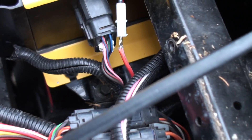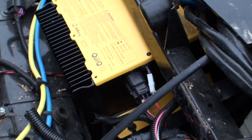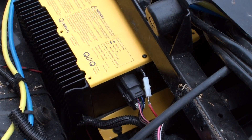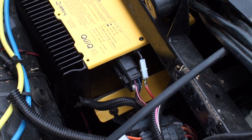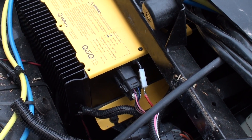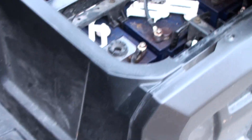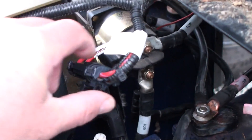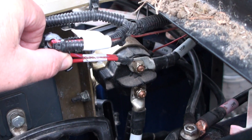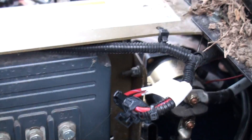Once I got this terminal — that one red wire connected back to the inside — basically my plug just runs through the side and bypasses the big plug. So just one wire did it. The other black wire is actually the ground wire; I didn't have to cut that and splice it. And that wire goes in and it goes over here to what you call your contactor, which is right there.